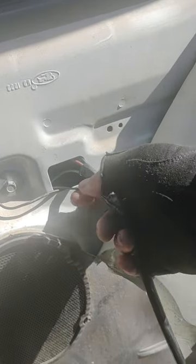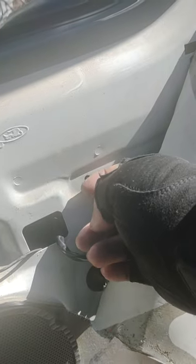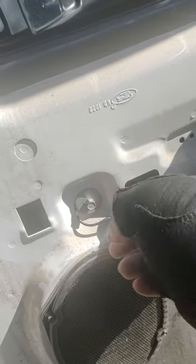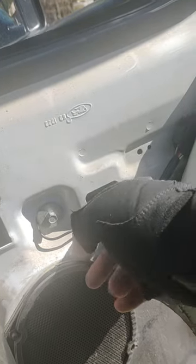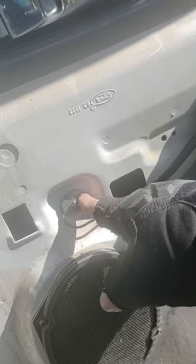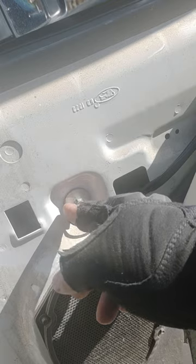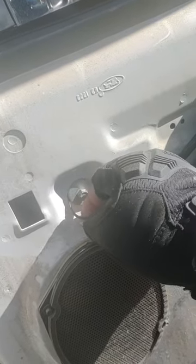As you can see, this black wire coming out of this loom here — I just got it tucked in so it doesn't get pinched or wedged when I put the panel back on. These two holes here are for the little keeper piece where the wires get pressed in and plug in. But with this being the XL model it doesn't have any of that — bare bones. All I did was back this screw out a couple turns, pull the washer back, slide the wire behind it, and crank it down enough to hold it. It's pinched but not about to break, so do be careful if you're going to do it this way.